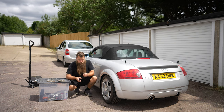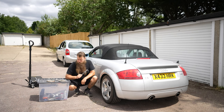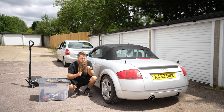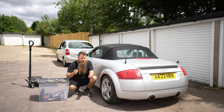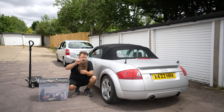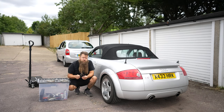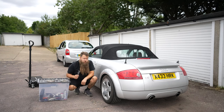The other thing to consider is wheel bolts. We had this debate when I fitted these wheels — you need to make sure you have the right ones. With an Audi they need to be radius, which means they have a rounded edge, whereas the other ones are tapered, which are more diagonal and usually for aftermarket wheels. I'd recommend getting yourself a vernier gauge or a ruler and measuring the length of your wheel bolt, because when you buy — say this is a 15mm spacer — you want the wheel bolts to be at least 15mm longer, so you have 15mm of extra thread which you're taking away when you fit the spacer.